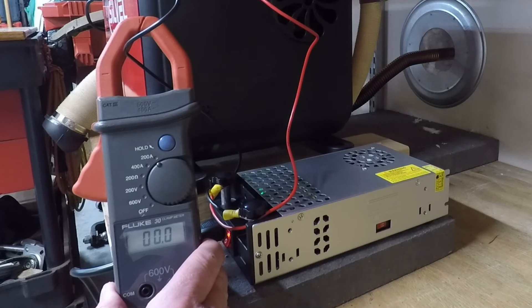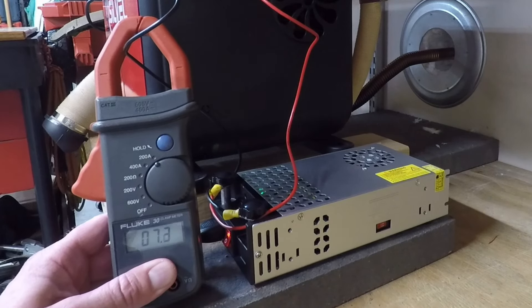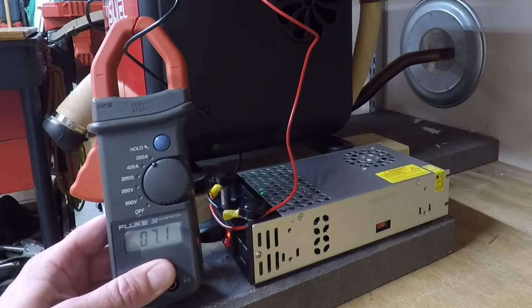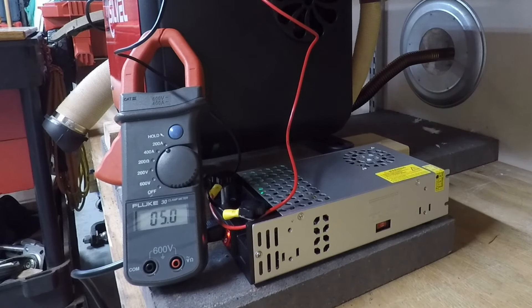I stuck my meter on there from a cold start and you can see how the amps start out pretty low, but with the fan running and glow plug on, we get up to about 7.3 amps max. Once you hit 7.3 it never seemed to go any higher. Then once the glow plug turns off it drops down to barely detectable. I'll speed it up so you can see how it bounces around during the warm-up cycle — about 5 amps is what it was bouncing around to. At about 10x speed as it's warming up and increasing fan speed, it hovers right around 5, and then when the glow plug turns off it drops down and hovers between a tenth and a fifth of an amp — basically nothing.